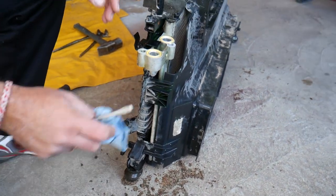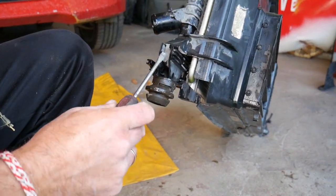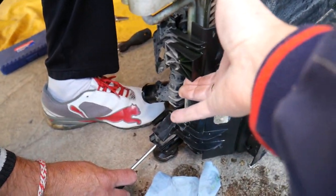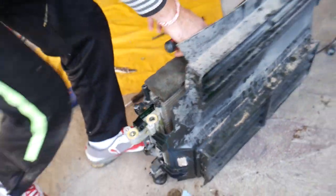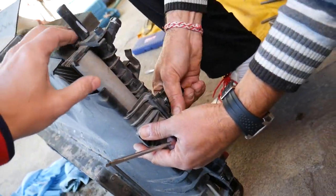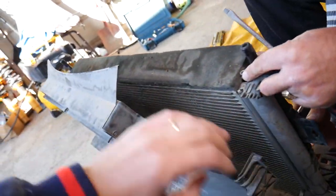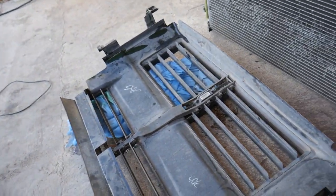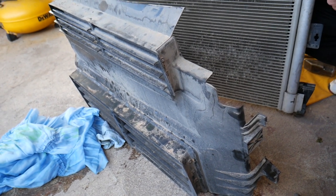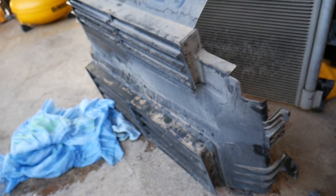Now here's how you disconnect the active grille shutter from the radiator. It's pretty simple — let me lift it up a little bit to show you. There is one tooth that you need to press in with a screwdriver, and when you press it in you lift it up. I think this can actually be done in the vehicle if you have enough room on top. Same thing applies on this side — right here is where the tooth is. It came out pretty easy, not as complicated as I thought. This is the active grille shutter — that's how you remove it. Hopefully this video is helpful. Thank you for watching, please subscribe for more videos. If you want to purchase one, we have the link in the description below.